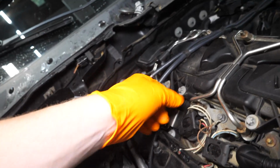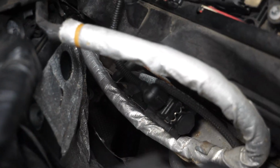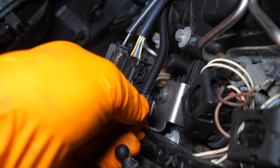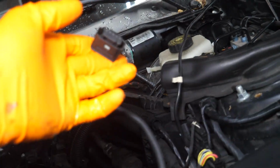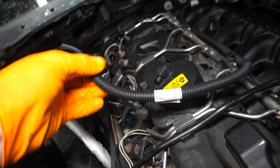And this third wire that this is connected to is just a little push connector right down here. Press on that little metal spring. It will pop right out. We have a little wire retainer right here. Press that to release it. And we should be able to bring these wires over to the other side as well. Disconnect the eccentric shaft connector here. Just a little press tab.